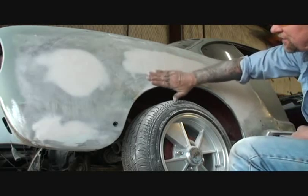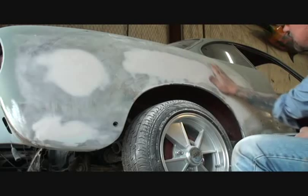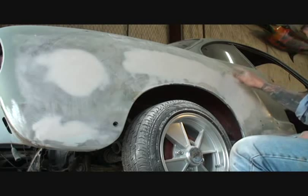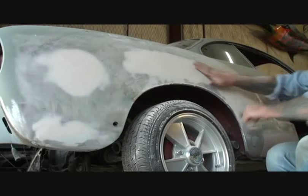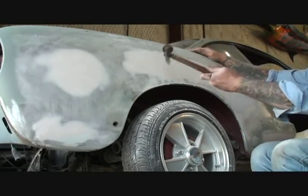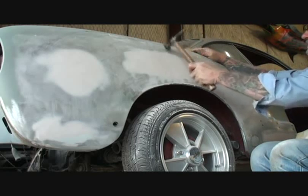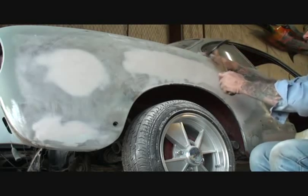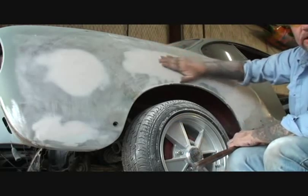To be on the safe side — because if it's flat here and then all of a sudden it's low there — I did have a ridge right in this area. I took my body hammer and I tapped that. What happens is when you have a ridge, where it feels like there's a valley in between the metal and the Bondo, you take your body hammer. What you want to do is tap it just like so, and then rub your hand across it again.